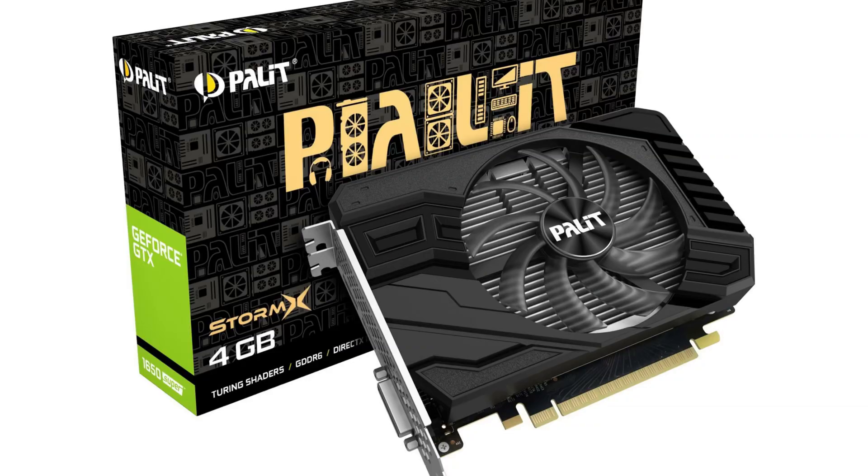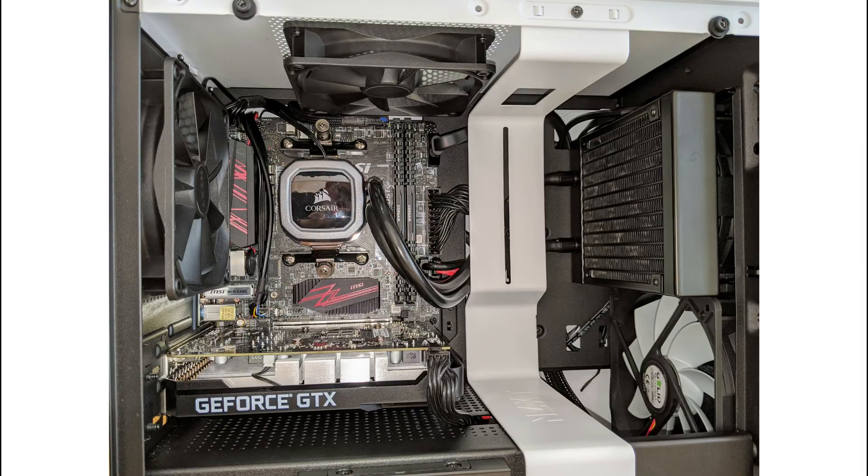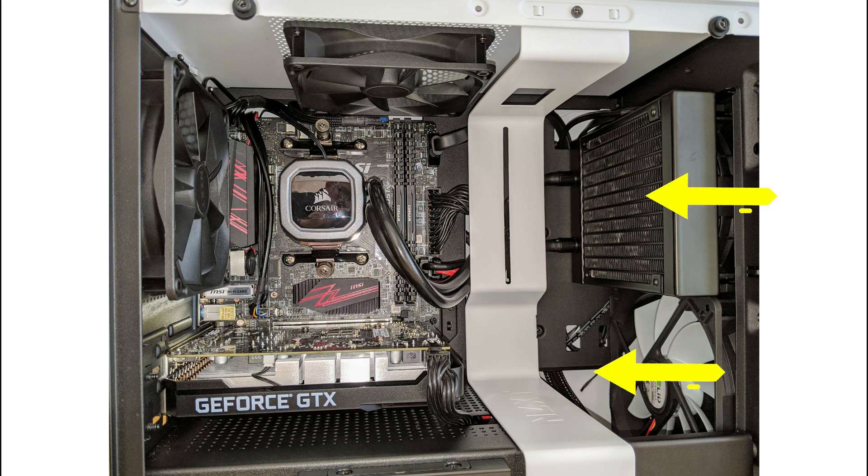So I'm just going to stress test the entire PC. I've basically got the Ryzen 5 in there at 4.2GHz, a GTX 1650 Super, and I've basically got all the fans set up perfectly. The AIO radiator is at the front of the PC and air is pushed from outside the PC — nice cool air going through the radiator into the actual case itself. Below that, we've got a 140mm fan pushing cool air from outside into the case, which is cooling the graphics card area.